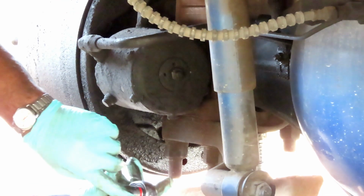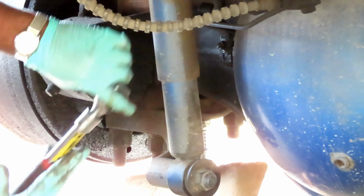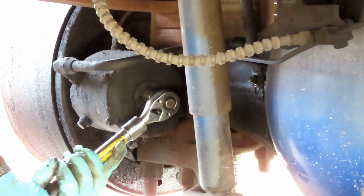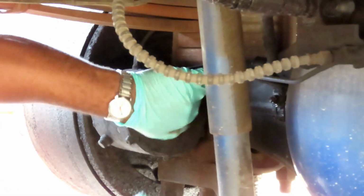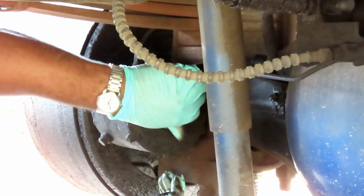All right, you want to get a 19 millimeter half inch drive socket with a half inch drive ratchet, and you're going to have a nut right here in the center. You're going to loosen that. Sometimes it's tight. Okay. And you're going to loosen it. You're going to bring it out by your hand